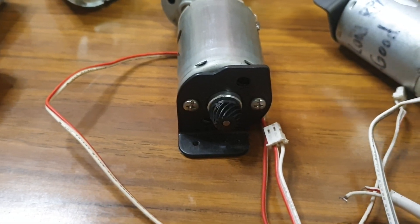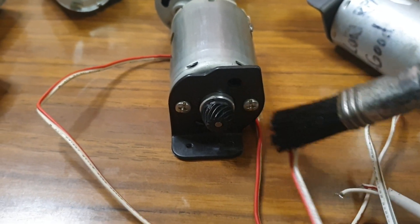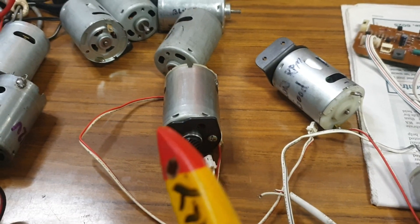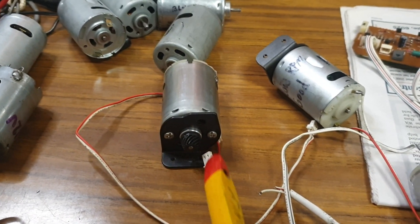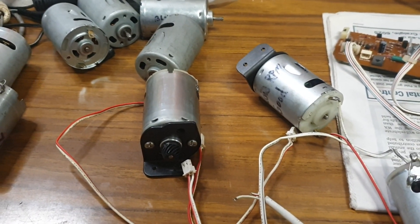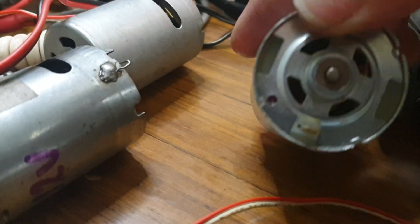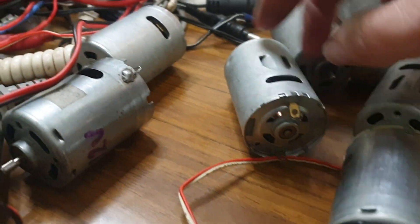I found it quite difficult using a finger to see which way it's going, but using a brush just flicks it down nicely. So just a little warning when changing the garter carriage motors: make sure you check which direction it's turning — it needs to turn clockwise. Once you know it's okay, put it back into your garter carriage and you'll be fine. Don't take for granted that the little dots you see are correct.